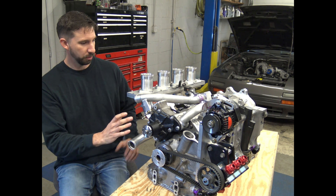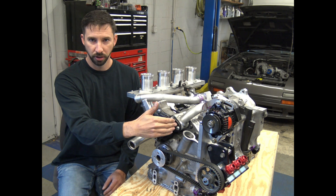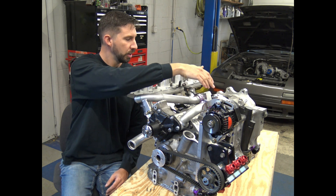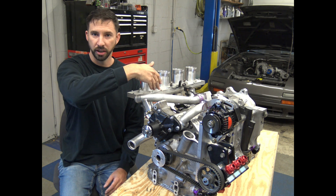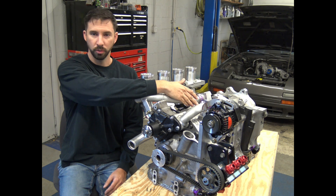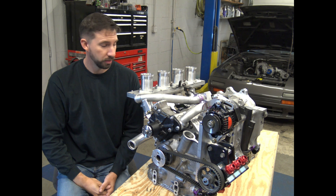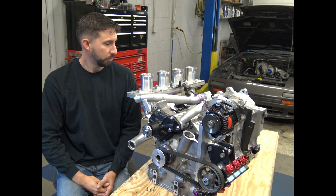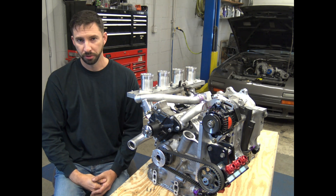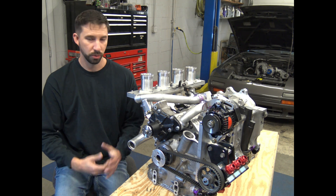The biggest thing is that you're using 13B rotor housings, 13B front and rear plate, and 13B intermediate housings. The biggest glaring problem with a four-rotor engine — and this is only a problem for certain applications — is that coolant comes in from the front and then travels all the way down the driver's side, makes a turn, and comes back up the other side and out the water pump exit. So the front rotor is extremely cold, the second rotor is just barely warm, the third rotor is very hot, and the fourth rotor is like evaporating-water hot. There are a lot of methods to try to correct that, and through playing with the three-rotor, which also has heat issues on the very rear two rotors, I've developed more technologies to cool these down.